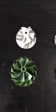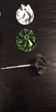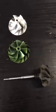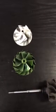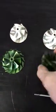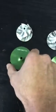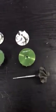Golf 7 GTI, Golf 7 R — together with the standard compressor, standard turbine wheel, without any other modifications outside of the bearing system, it is just a compressor wheel upgrade, bearing housing machining, as well as CNC machining on the compressor housing. This will yield the 400 to 450 horsepower upgrade, and that's exclusively available by Turbo Direct. We are the only ones in the world that make these wheels — designed by us and manufactured by us and us only. So those are the two options that we have.